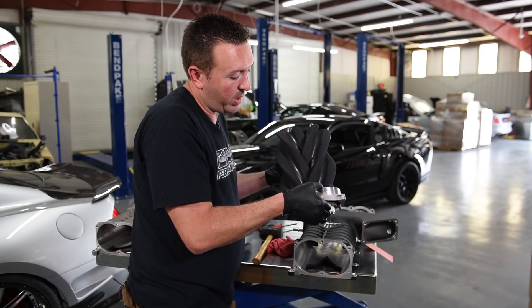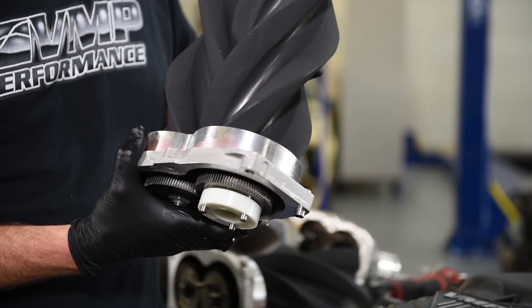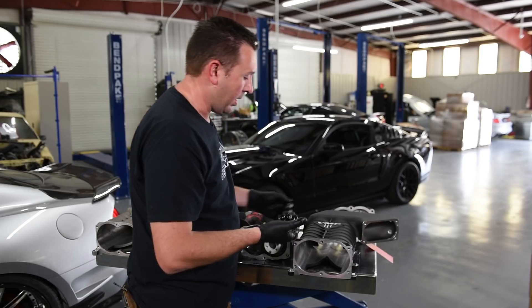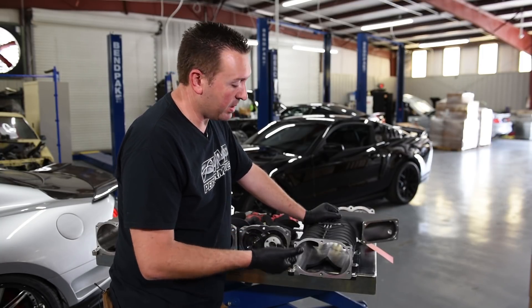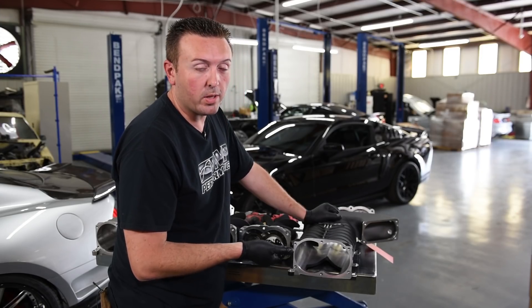You can actually see a little bit of red film here. The nose drive is sealed to the rotor pack with Loctite, and then the rotor pack is sealed to the main housing with Loctite. The Loctite offers a really good seal without adding any thickness that might distort the mating surfaces or cause the bore of the supercharger to be pulled out of alignment.